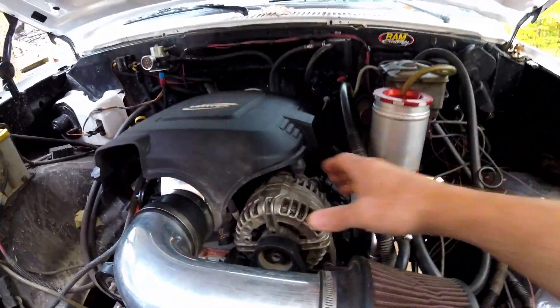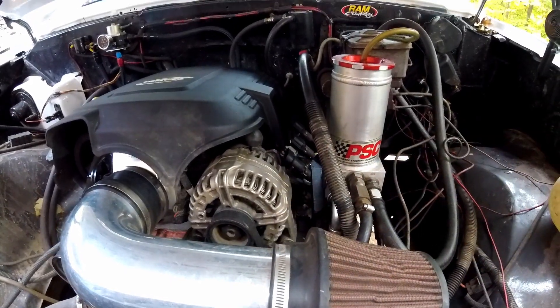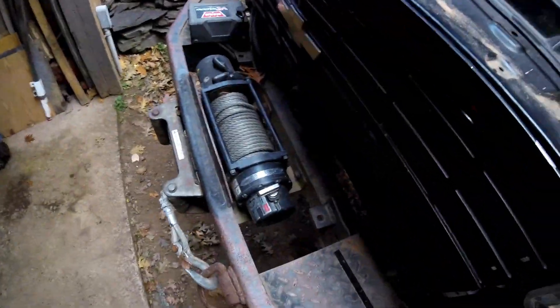I'm going to swap it out to that other alternator. If you put a resistor in it — they say like a 470 or 490 ohm resistor — put that in line into a keyed 12-volt source, it will, when it's running, show a draw and charge properly and give you the full voltage. I've been running into issues. I run two batteries because I have an inverter in the truck, and I've been running into issues where the battery isn't charged up enough. If I go to use anything under demand, like spooling the winch or using the inverter, it's going below 12 volts pretty consistently.